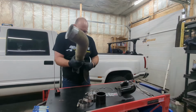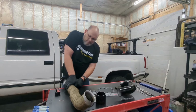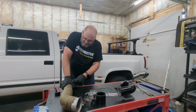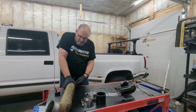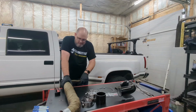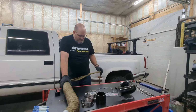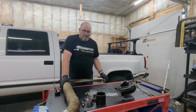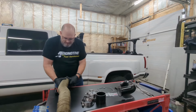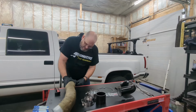You know, and then yes, the 6.5 diesels are definitely getting a lot harder to find the blocks for. You can buy new ones, like the GM Optimizer blocks. There are definitely shops doing newly rebuilt motors, like Leroy Diesel, for example. They offer a fully rebuilt motor package, and they're all reasonably priced. For me, I got lucky and found a block that had a very, very minor crack in it. We had it lock stitched to repair it, and we were able to save that block that I located and use it for this build. So I'm happy about that.